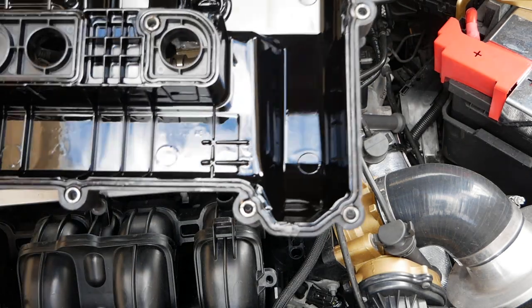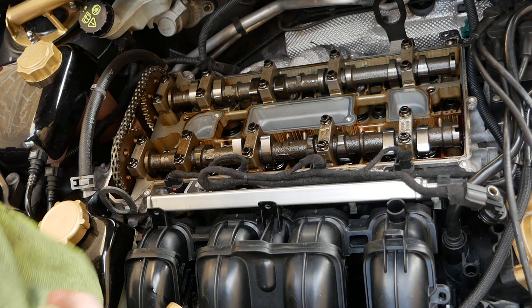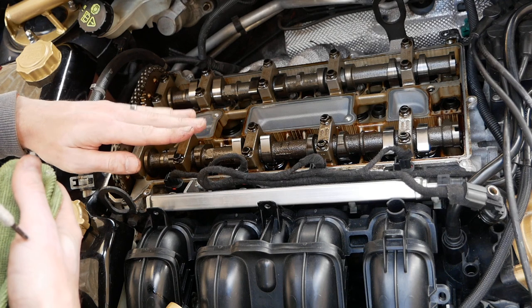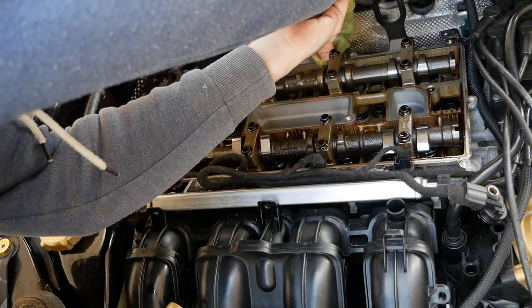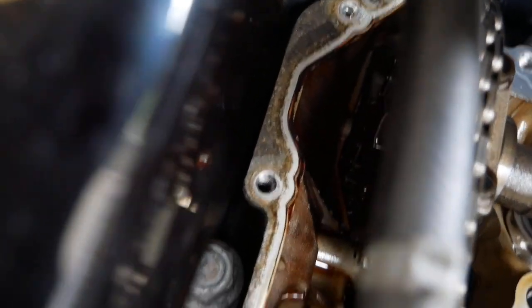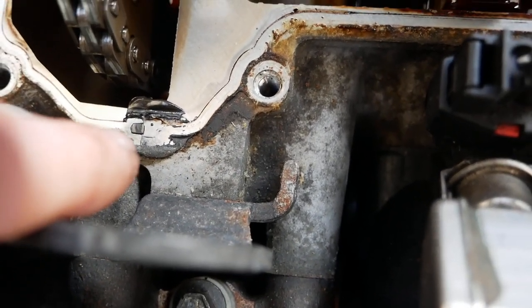Now that actually looks pretty clean. How cool is that seen inside? What I'm going to do is wipe along all the edge that's going to be resealed with the new gaskets — all this inside, but I'll wipe from the inside out because I definitely don't want to be getting anything on the inside of the engine. Just to show you, that's what the edge looks like there, but over to the right where I've been cleaning it, that's all looking quite nice now. And there are two little areas that you need to make sure you clean.